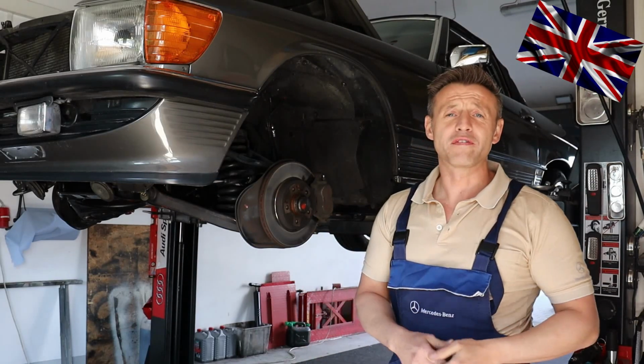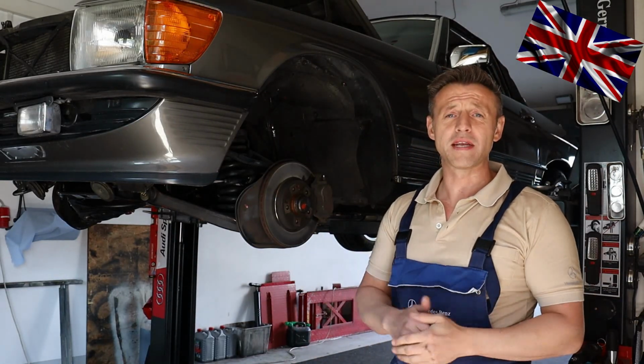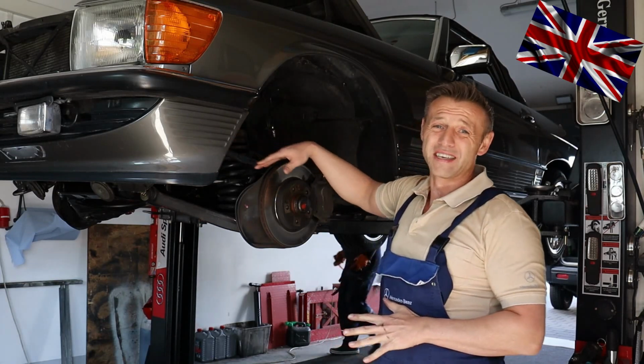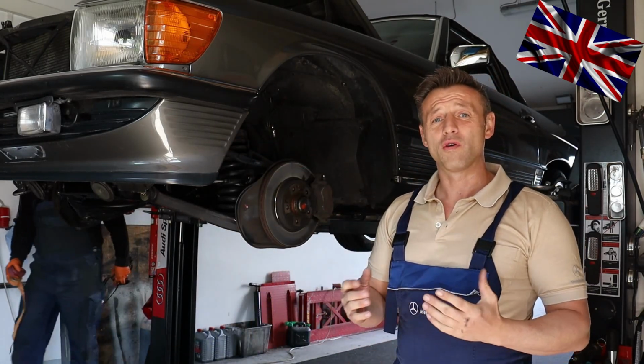So what did we get accomplished anyway? We have changed the rubber pads off the seats of the front springs to have a little less road clearance by using thinner rubber pads with only one notch. Like this, the vehicle is 1.5 centimeters closer to the ground.